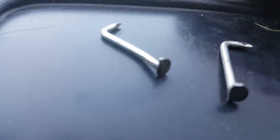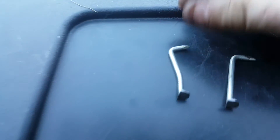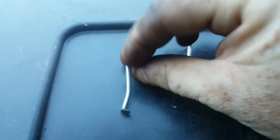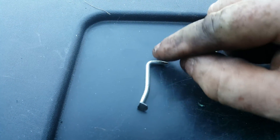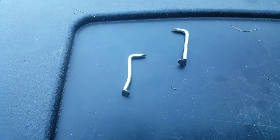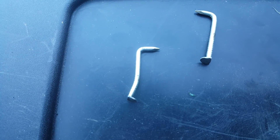You can make two of these, or you could just use a screwdriver, but this works pretty slick. It's my ten-cent seal puller — works good for some seals, maybe not all. If you had a longer nail you could get better leverage; you need a bit of a bend here. Anyway, try it out — check out my website, subscribe — that's how I pulled the seal on my main crank.